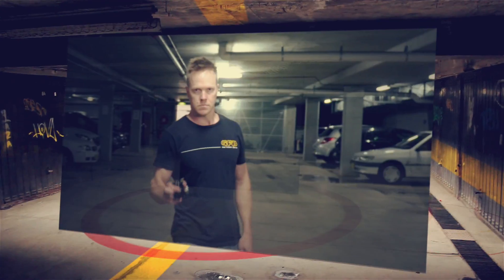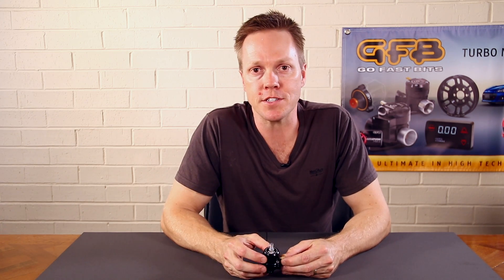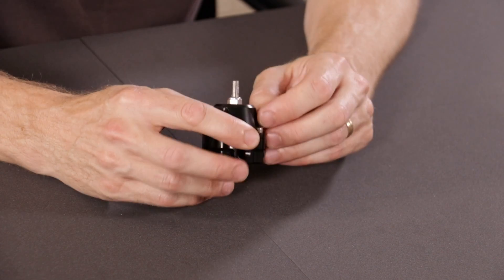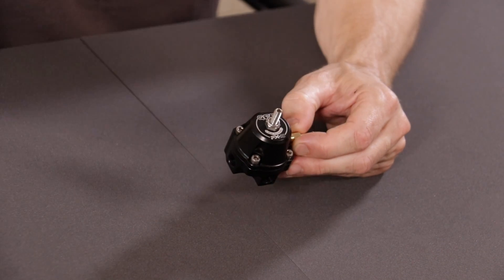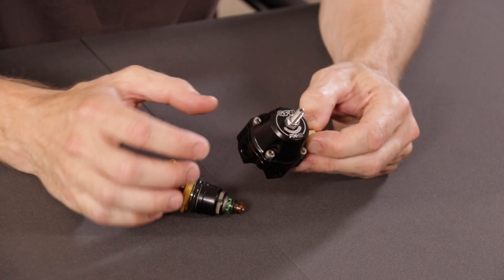In this episode of Go Fast Brett: what does a fuel pressure regulator do and how does it work? A fuel pressure regulator's name pretty much gives away what it does — it basically just controls the fuel pressure that gets to your engine's injectors. It's necessary to have a stable and accurate fuel pressure behind your injectors because when the ECU fires that injector, it needs to know it's sending the right amount of fuel into the engine so that it accurately controls the air-fuel ratio.